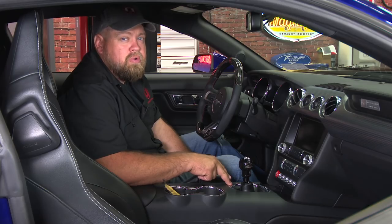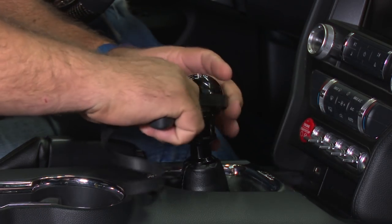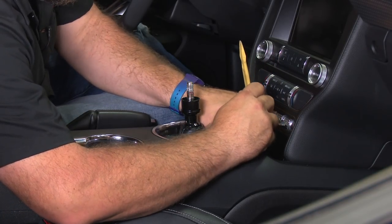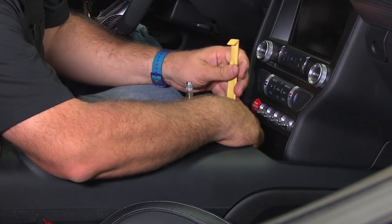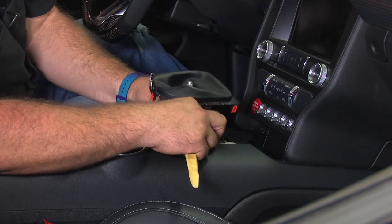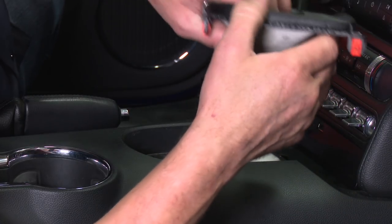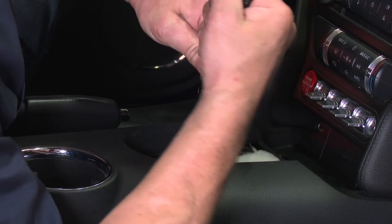We're going to start with the installation inside the car. I actually started under the hood by disconnecting the battery. The next step is to remove the shift knob and the boot. In my case, I have a Barton Hybrid 3 shifter on my car which is attached to the transmission, so that will come out underneath the car. Either way, you want to start by removing the shift knob and boot from the interior. The lockout goes into one solid plastic piece with the Barton, so it is a little bit harder to remove than the factory one.